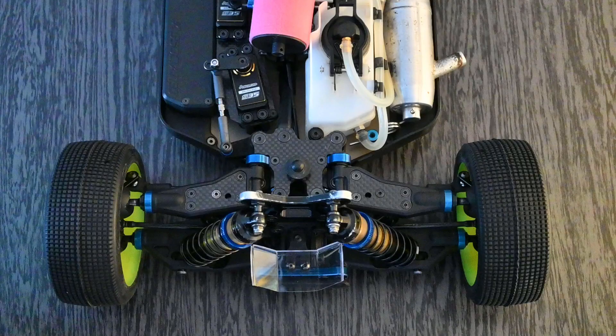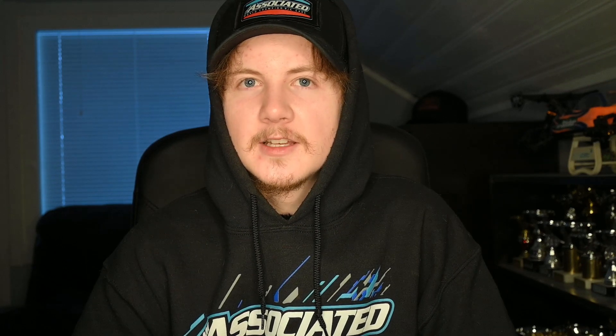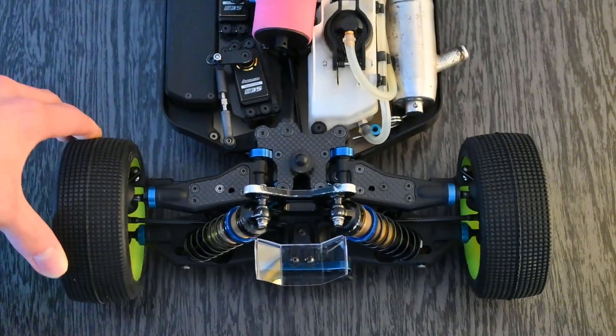Now to the front end. In the front end we usually run toe-out. Toe-in is possible but in most scenarios we run toe-out. Tuning this is much more difficult — there's a lot of different things affecting the front end. First of all the wheels turn, and second of all there are lots of different angles in the front, for example the caster, the steering geometry, and all of those sort of affect how the front end works. Toe on its own is not as big a deal in the front because there are so many other variables.